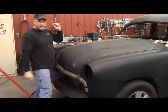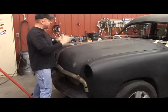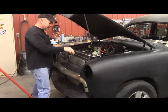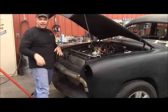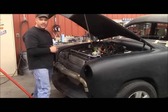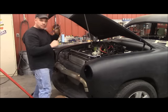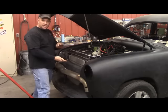I've got your plunge straight down the center so the body is exactly in the center of the Explorer. I shot that line off the roof because I know the roof is straight, and then I'll adjust your sides to your wood - this will be right on the money. You can see how nicely and beautifully that hood is fitting. I've had this hood up and down a gazillion times every time I've done any modifications on these strut bars and stuff. I've had to take this thing completely apart and put it completely back together - every nut, every bolt - just to make sure I've got an exact location. In doing so, I was able to make both your mounts exactly the same height and both your bushings exactly the same thickness.